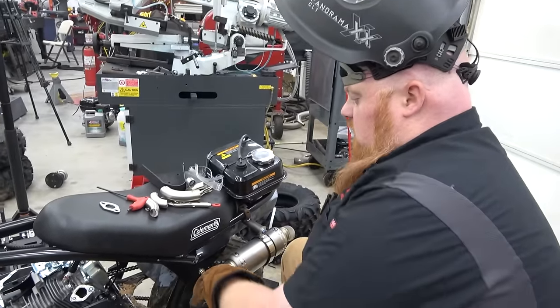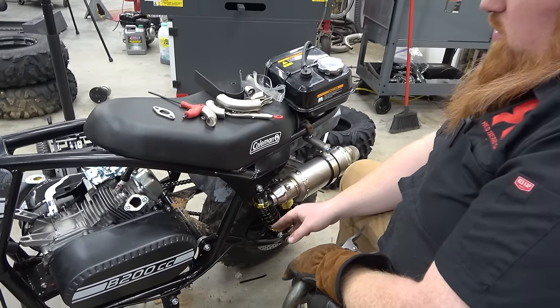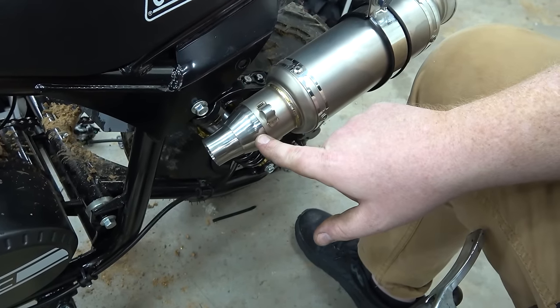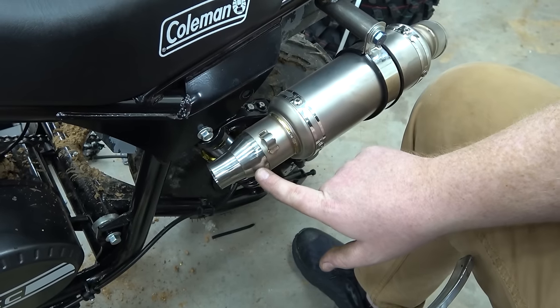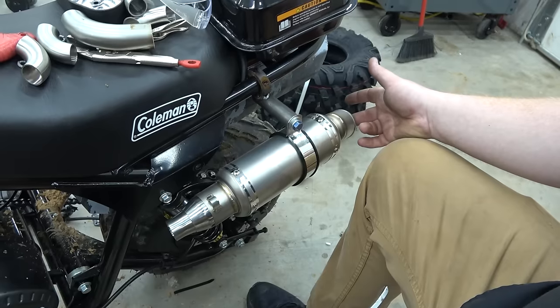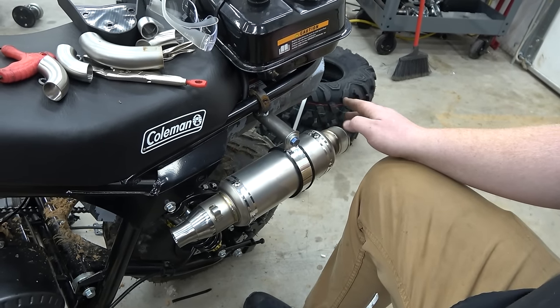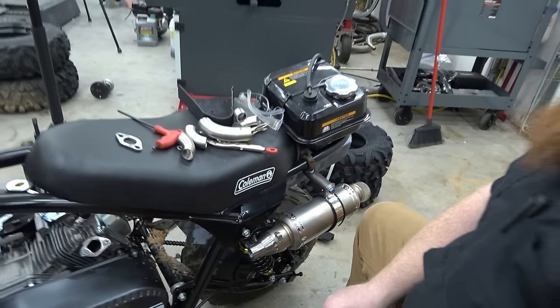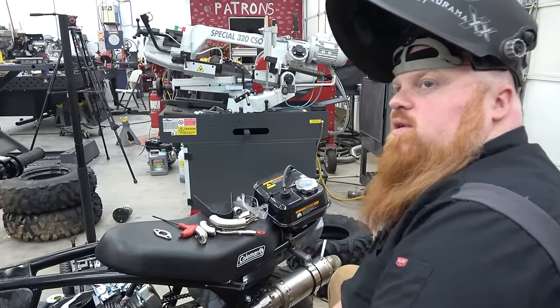But so I got a reducer in this muffler. This little reducer here reduces this down, I think it's a 1 1/4 up to 1 1/2 inch reducer. This is factory, comes with the muffler. These are the mufflers we sell on rbgcars.com. They got a resonator, or a silencer, in them, and they work really well. Like, they sound stock with the silencer in, you pull it out, they sound like a sports bike. Not really a four-wheeler or something.